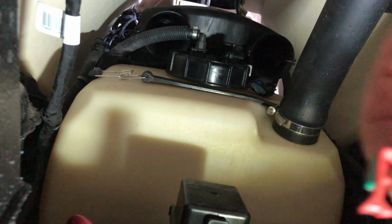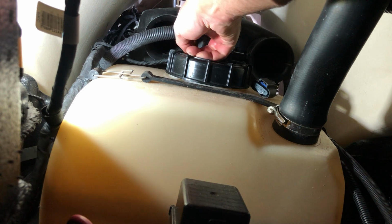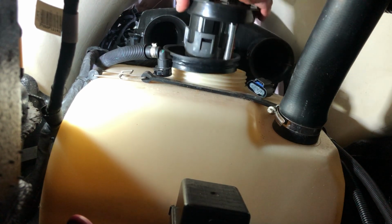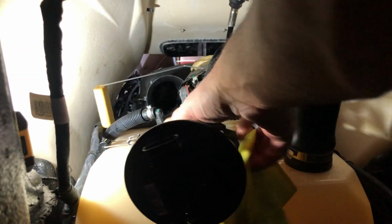To remove the pressure side of the fuel pump, the hose, there's a small red clip that comes out first. To remove the elbow, there's a small button that you press, and that'll let you remove the fitting. If you've got gas in the tank, there's no way to get around this. Just prepare yourself with lots of rags. The fuel pump float assembly drags fuel out with it.